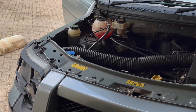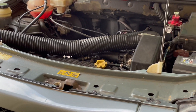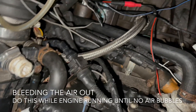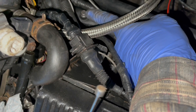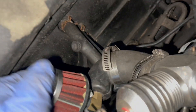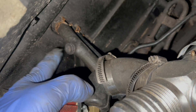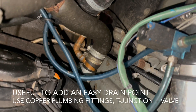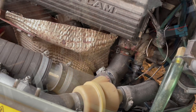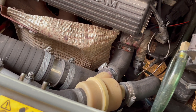Thanks for watching — hopefully that'll help keep K-Series engines on the road longer with fewer overheating issues. There's a more detailed description of the failure mechanism in the video description if you're interested. Don't forget to bleed all the air from the system: there's a bleed bolt on the coolant pipe and a second one on the pipe going to the heater — open those with the engine running until no more air comes out. And while you're at it, why not use some copper fittings and a valve to make draining the radiator easier. Thanks for watching and good luck with your DIY!